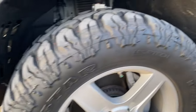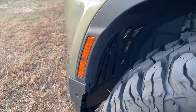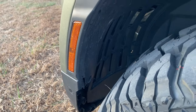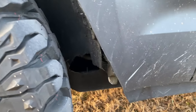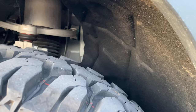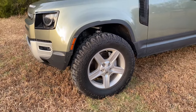As you can tell, we've trimmed a lot in the front section, and of course a lot in the back section of the front inner fender well liner. I also did the intercooler relocation kit and had to trim the inner fender well liner quite a bit as well. With all that, it clears pretty darn good, but there are still a couple of situations where it does rub ever so slightly. Land Rovers put a lot of sound deadening all over the vehicle, so some of the extra stuff needs to be trimmed off as well. But it's pretty impressive that you can clear these 35 1250s on just a 2-inch lift rod kit — that's pretty inexpensive.